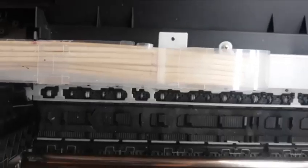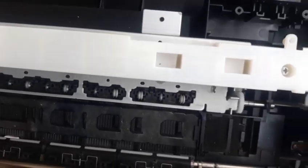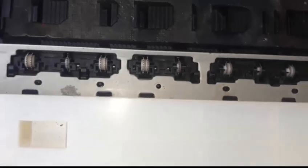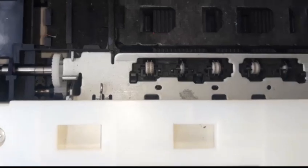At the front there is a plastic panel that needs to be removed. There are about three screws there which you need to remove as well. Once you remove those screws, bring out the plastic panel. Then you can see the inside of the printer — all those rollers you see there are the front paper rollers that we need to remove to convert our printer to DTF.